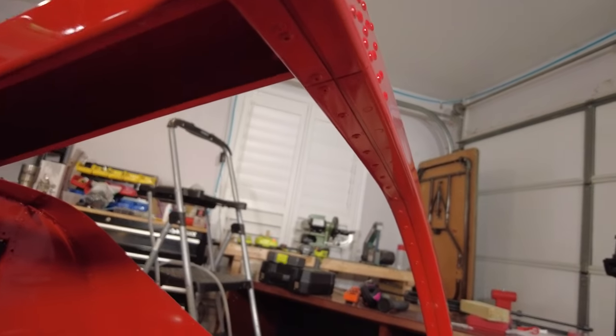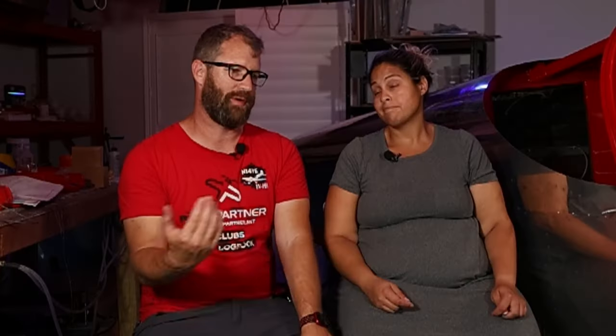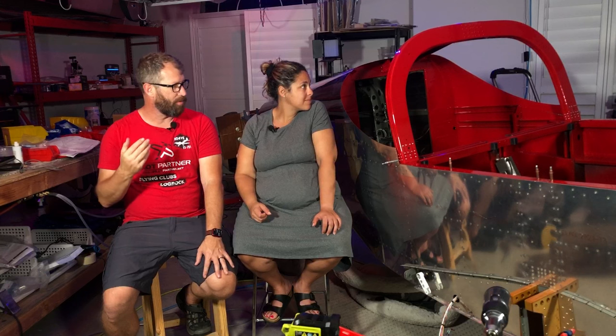I'm wondering if when we were building the roll bar, we put a little bit of a twist in it — trying to keep it flat and level while struggling to get to things and flipping it around. Lots of pull rivets, regular rivets, and lots of countersinking. We also countersank a little too much — the forward bottom side is not supposed to be countersunk and you're supposed to use 470 rivets there. We were in countersinking mode, so we countersank without thinking about it. No problem — we just switched to 426 flush rivets. Actually kind of glad we did. It's nice and flush.